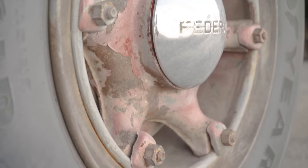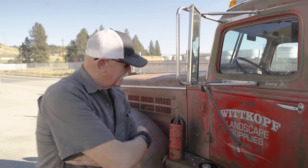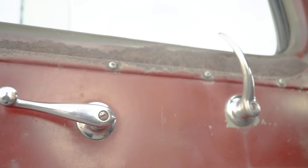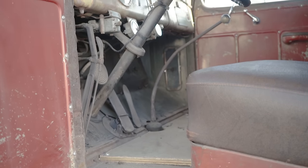I don't know how anybody would drive it in slow because it only does 10 miles an hour in slow, and it does about 30, 32, or 33 in high. Pretty low rear end gears. It's got a deep underdrive in first gear too — you put it in first and deep under and you're not even moving. Walk backwards faster. If it was loaded it would still move, just not very fast. It's got plenty of gears to climb, just no power.